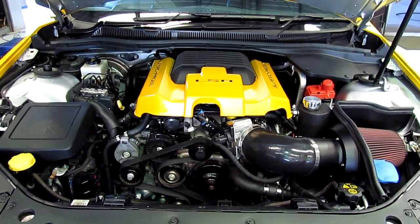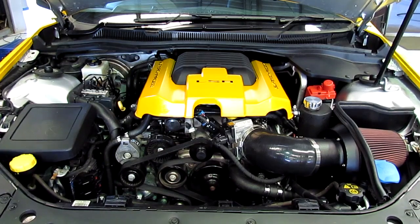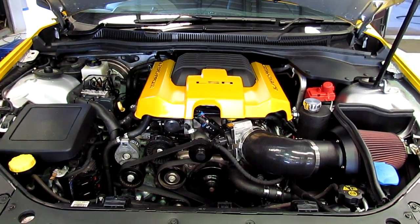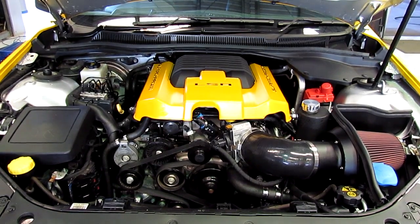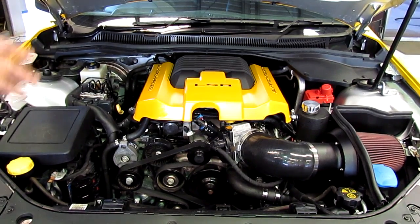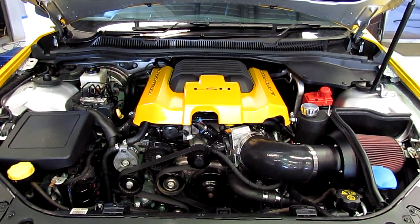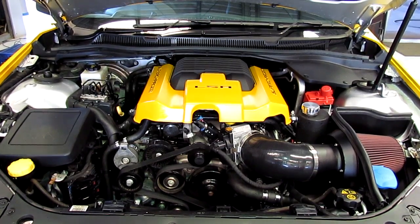But because he's not planning on staying with this supercharger, we've stayed with that and just gone to a 10% on the bottom. So it means it's probably running somewhere between the 23 and 24% overdrive, so really a little bit too much, you're spinning them pretty quick. But on that level, it's all working fine, and like I said, it's an interim step. There's a bigger supercharger probably next year, but at the moment, spinning that little compressor fairly hard on top of the 6.8 litre or the 416 cubic inch engine. We've raised the compression ratio back up to the normal sort of place to get the most out of them, and then we've run a different camshaft, like I said.